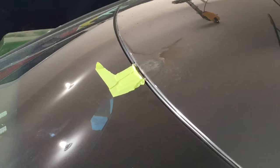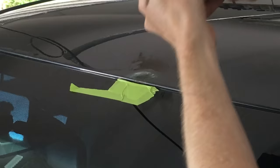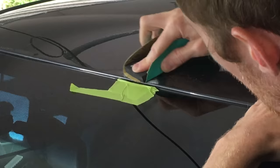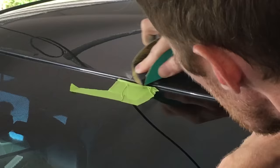So I'm going to use some 80-grit sandpaper on a sanding block. 80 grit is really rough, so it'll go down to bare metal with no problem. The reason for the sanding block is so the paper will have a more uniform, flat contact surface than if it was just my finger behind the paper — that can cause low spots and lead to an uneven surface. Also notice I'm changing sanding directions; an opposite crosshatch pattern sands better than the same direction. Look at all of the rust I'm removing now that I didn't get with the wire brush.